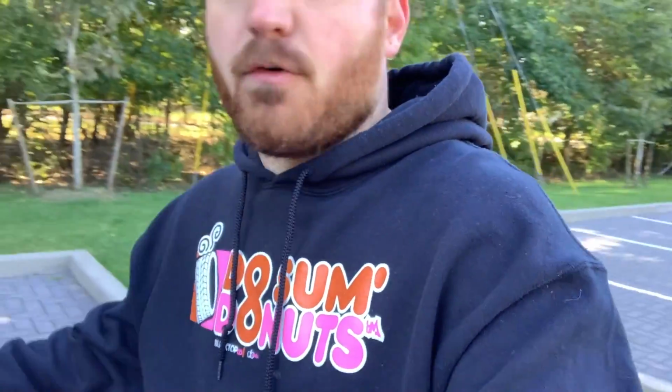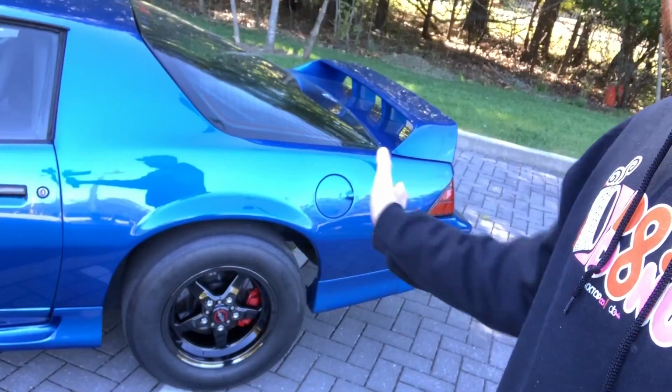But also, if you have a 4th gen, or you want them to sit in the stock location as a 4th gen wheel, so pretty much all the way pushed in where a stock wheel would be, you'll need the 7 1/2 inch back spacing. But once again, that's only if you have a 4th gen rear. If you have a stock 3rd gen rear, I'm not exactly sure what the back spacing is going to be. I want to say it's like 5 1/2, but if anybody knows, definitely leave a comment below and I'll pin you so everybody can get that information.